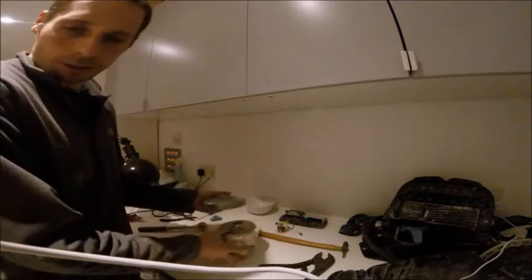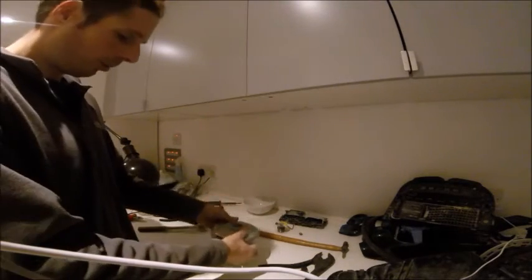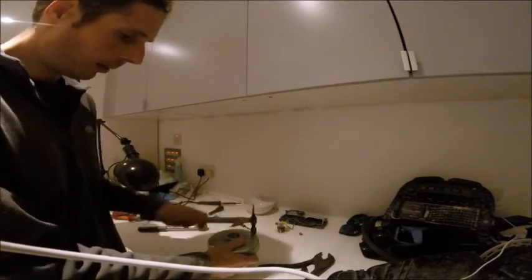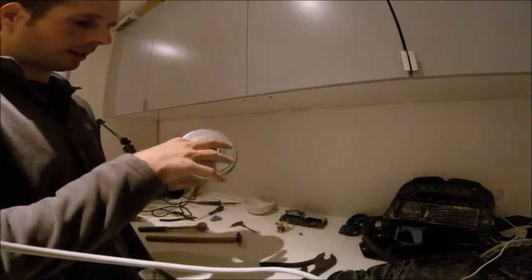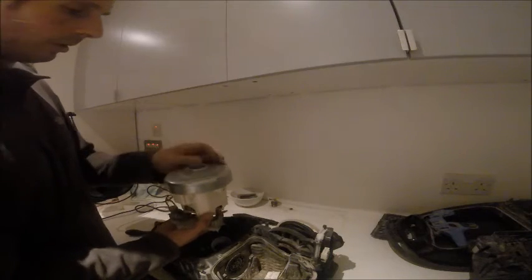Next piece is the metal shroud that goes on top. Just push it on top and tap it down with a hammer. The impeller should turn smoothly inside there once you've done that — check it. Then put the rubber piece on top and now we have the motor. Put the rubber sleeve on top, the rubber grommets on the back — it needs to be up this way so the clip is at the top. Then it just slots down in, click the clip back in, and you're done.